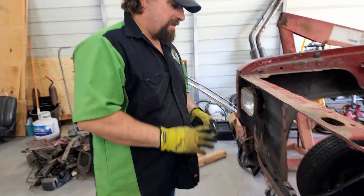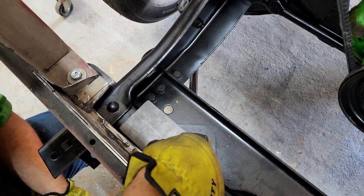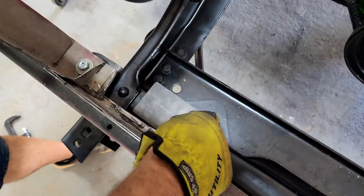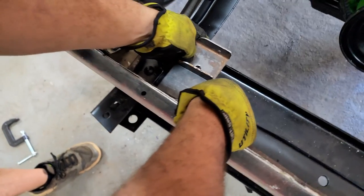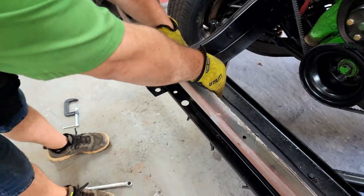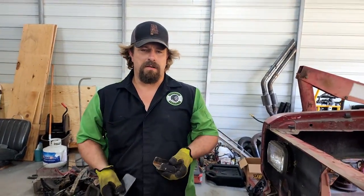I have a plan. I cut this 3/16 plate out. I've got just a Jeep rubber bushing under there. It's got plenty of movement, so it'll be okay. And then we'll weld this on the front of it like that. And that gives us a place for the radiator to sit. And then this plate over here can be where we weld our hoop for the front of it on. I'm gonna go ahead and get these welded on before we put them in there.